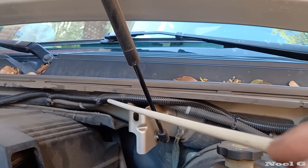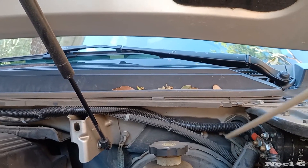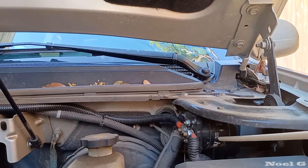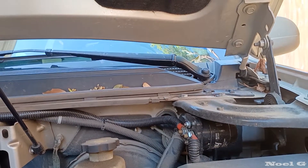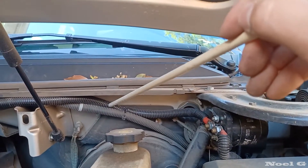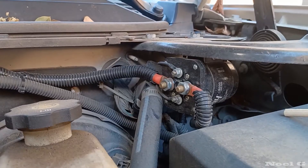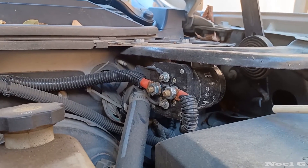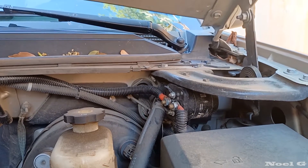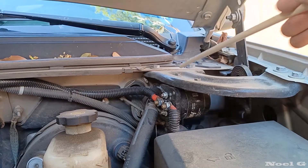So then it comes across here, this line is coming through here, and it's going to enter into my solenoid. This is a 200 amp continuous duty solenoid — I'll link to the exact one in the description below. So the positive coming from the alternator slash battery comes in right here. There's going to be a total of four connections on the solenoid. One of the things that seems tricky is finding a way to mount the solenoid, and they put it on the underside of this bracket here — it's screwed and bolted in.